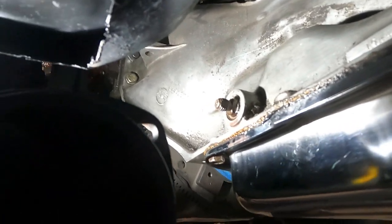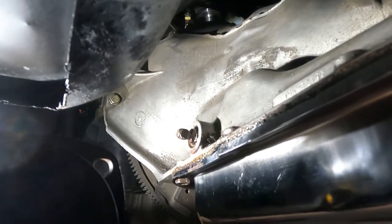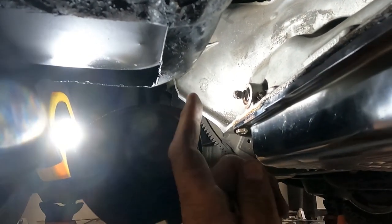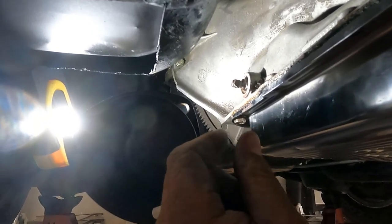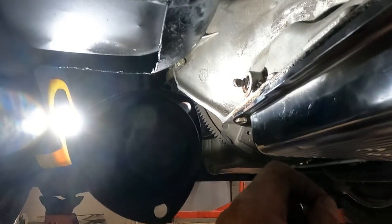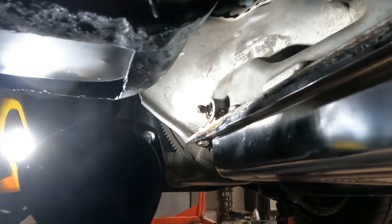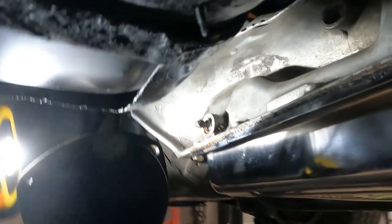Don't mind the fans — a little balmy again in South Dakota. I'm going to try and get you positioned so you can watch the shenanigans here and see if we can get that to come out first run. You kind of drive that tool in and then you turn it and it bites into the rubber side of the seal. Then you back it back out and we'll put the other seal back in, and that'll seal up one of the mini transmission leaks we had with the old snake eater, car biter — I don't know what the hell we're going to call this thing.